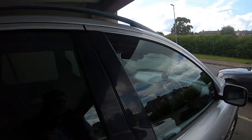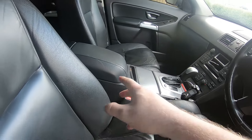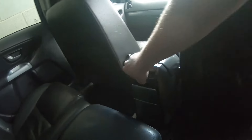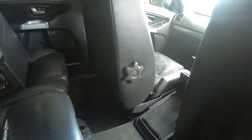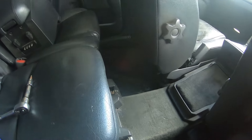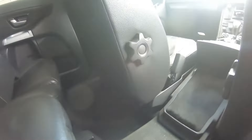It's now the next day so I can start digging a bit deeper. I need to remove this centre console and it's actually in two parts. The rear section is easy to remove - there's a lever here and you just pull and the entire rear half of the centre console comes out. I'll put this to one side, and then this panel needs to come out. I've got a trim tool here, so it's just a matter of prising it out.